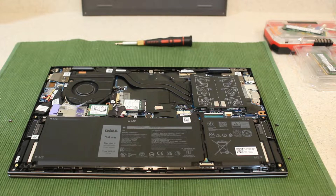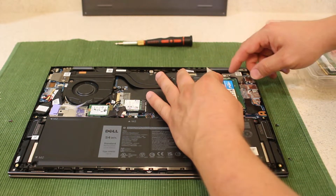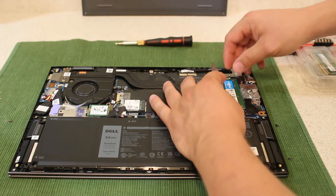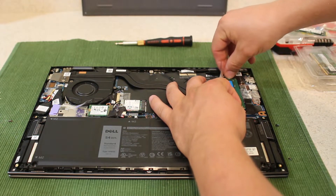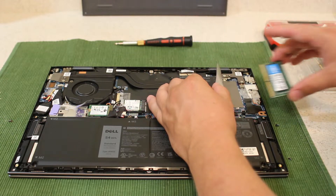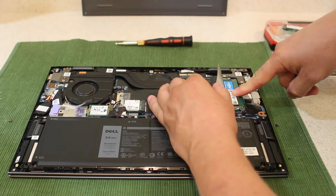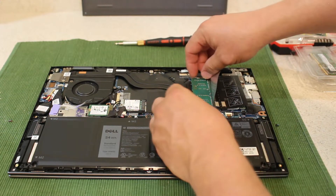Alright, let's take a look at what we got here. So this is the RAM area. I already put the new RAM in, and this is what it'll look like. On the right side you'll see the sticker is facing up. Just like all other laptops for over 20 years, it's the same system — you've got these two little pins. Use both fingers to release them and it comes right out smooth. This is how you put it back — press it down, you hear that click, and the first RAM stick is in. On the left side you have the same setup.